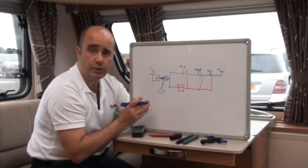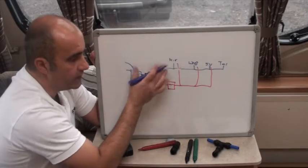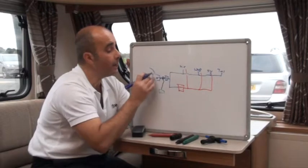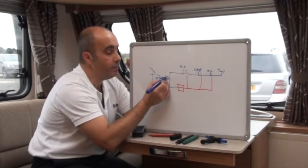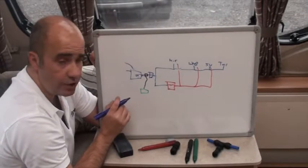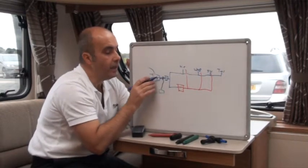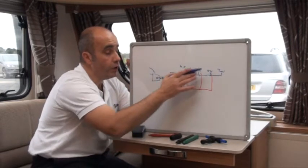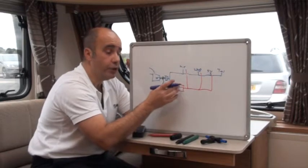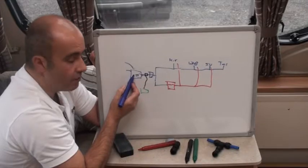Flow should really only need about 15–20 seconds at the beginning to build up pressure. People may worry about the pressure — but pumps in the tank, barrel, or on board generally operate at 20 psi, and we're operating at 15 psi. The air will travel through regardless of whether it's a diaphragm pump or impeller pump. It will also travel through your water heater — which you'll have drained first by opening the dump valve, then closing it again to seal the system.